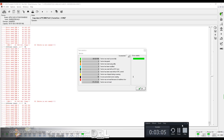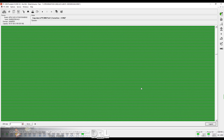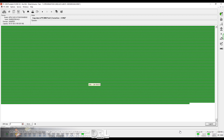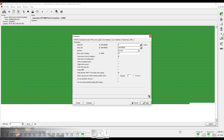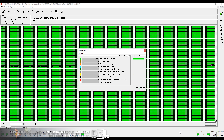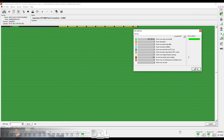I'm going to fast-forward through the imaging — this took a few hours. There were about 50-something bad sectors and you can see them in these black spots. In different locations there were more, and I think 130 bad sectors in total. I changed the block size to try rereading those bad sectors, but unfortunately those sectors were beyond the drive's capability of reading — there was just too much damage on the platters. We skipped those, but I don't think that section of the drive was much of an issue.